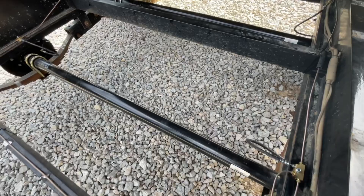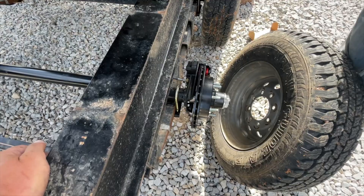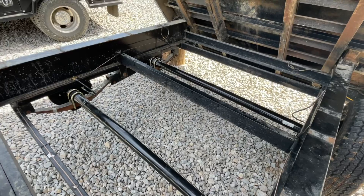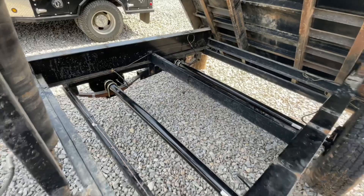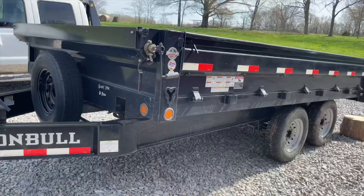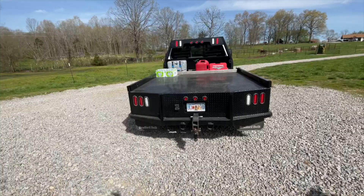Let's give you a brief overview of what we've done here. We've got two brand new axles — though you don't have to have new axles to do this conversion. Our friends at Lippert totally hooked us up. We have disc brakes and calipers. We've run hydraulic brake lines, and it's going to function very similar to your electric brakes as far as the controller goes. We're going to get these wheels on and take her for a test drive.